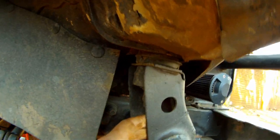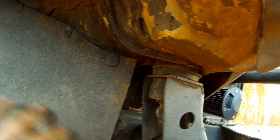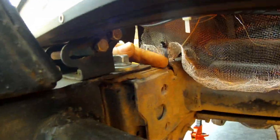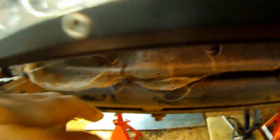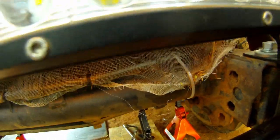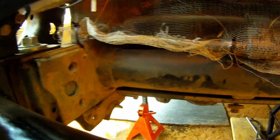There's a lot more space at the top here, giving good access to this part of the tub if needed — the Land Rover is very tight in there. The front of the chassis has got another outrigger right up at the end; on the Land Rover it's all bolted in with the wings, which are a structural element. The front of the body here is attached to another outrigger through bushes, which doesn't exist on the Land Rover. The Land Rover has a thick square cross-section crossmember at the front — this one is tubular, though it just needs to brace the chassis front and back. In terms of an accident, they probably both perform as poorly as the other since they're both just big girders of steel with no crumple zones.